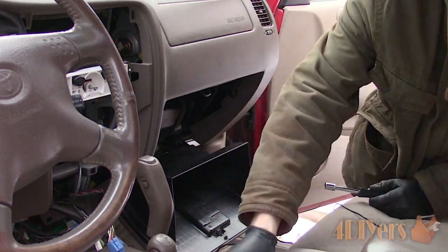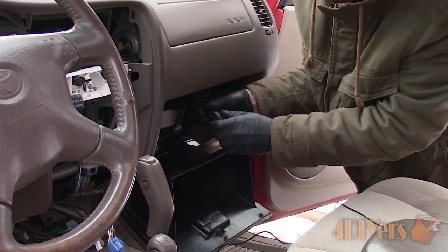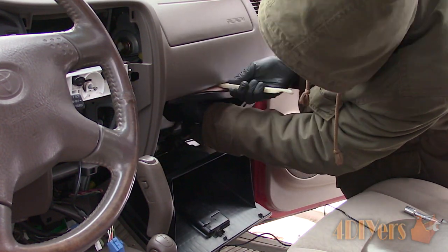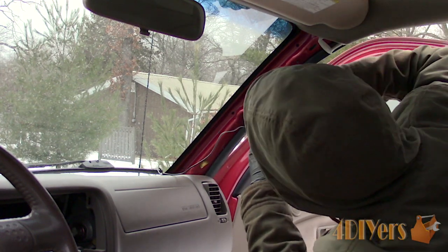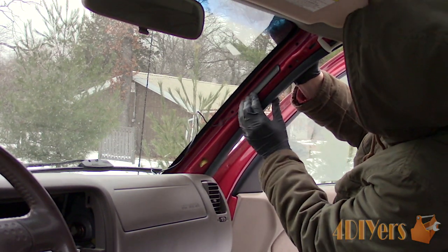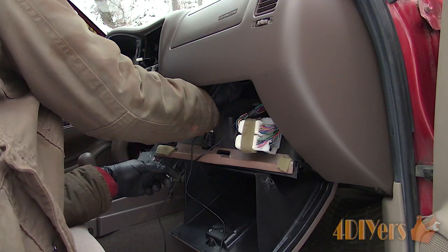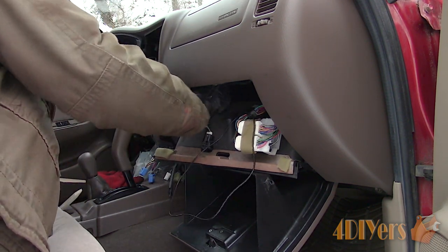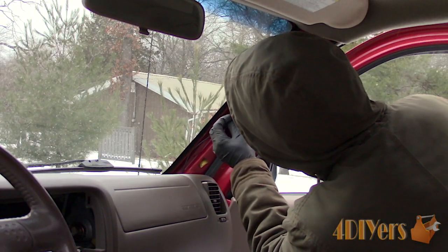Next is removing the upper panel above the glove box. There will be three 10mm bolts holding it in place — two at the top corners and one behind the latch. Using a nylon trim tool, unclip the panel by the dashboard side and on the sides as well, then pull down. No need to disconnect the wires behind. Ensure the area is clean where you are gluing on the antenna — use isopropyl alcohol to wipe the surface, remove the paper off the adhesive, then firmly press the antenna into place. The higher the antenna, the better the reception. Feed the wires behind the dashboard and pillar, through to the radio opening. The airbag is here — make sure the cable doesn't interfere with it.